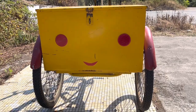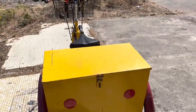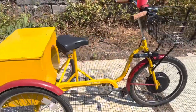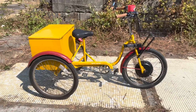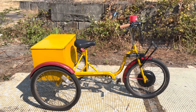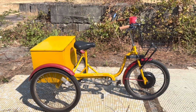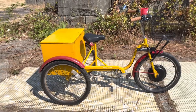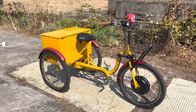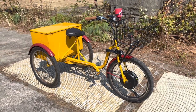Look at that trunk, you guys — look at the size of that trunk. The versatility is just ridiculous; just imagine the possibilities. This will take me up any hill around here with the motor and the controller at 48 volts. The 52-volt battery doesn't really change the performance profile of the bike very much — those of you who have been e-biking for a little while probably know that. The 52 volt just does a great job of resisting voltage sag throughout most of your ride and delivering close to the same performance all the way to the very last mile.